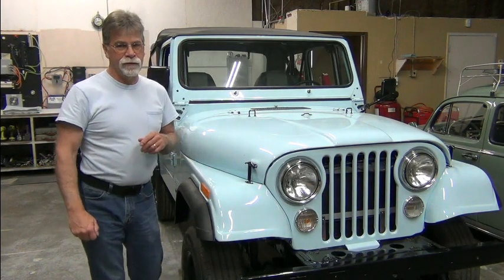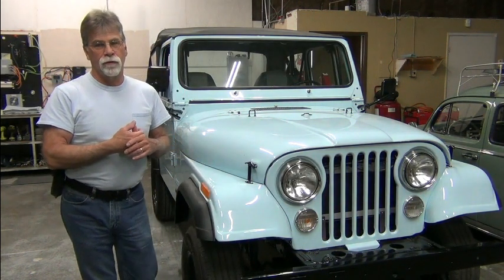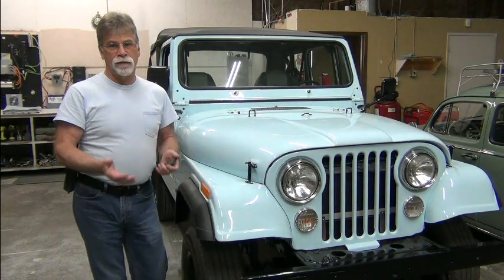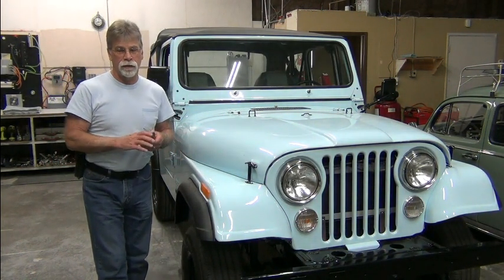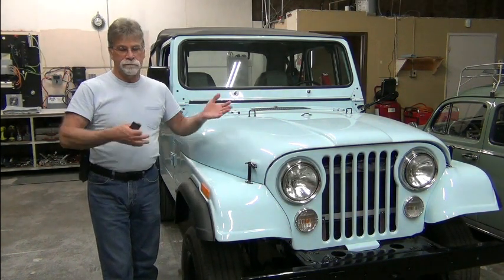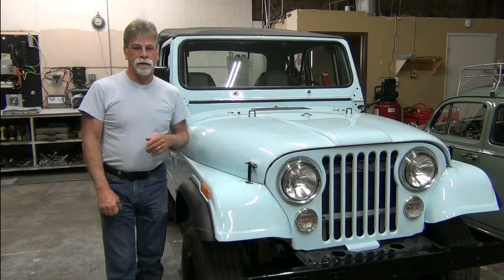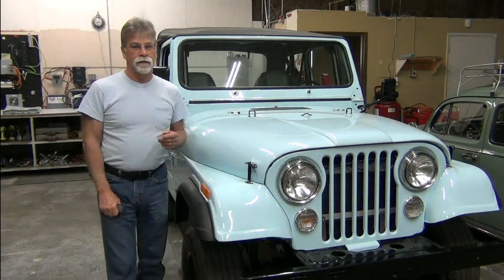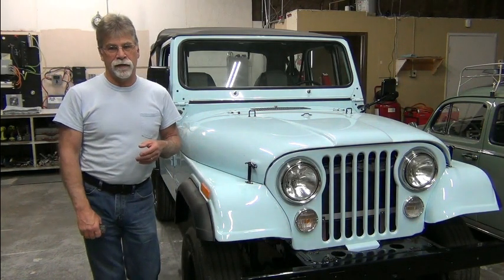We noticed pretty much out of the gate that the battery cells weren't really properly contained. The ones in the front box were in a box, but there was nothing holding them down, and they could actually bounce up and make contact with an aluminum component board above. The cells in the rear had a plate holding them down, but they really weren't properly contained in the back. They just went up against the tailgate to the back seat and between the fender wells and were loose in there. So those are the things that we knew we had to take care of first.